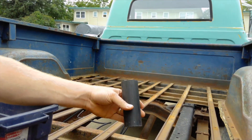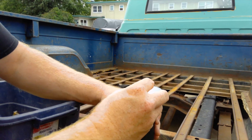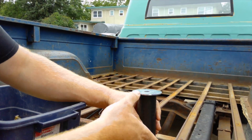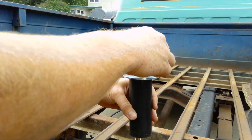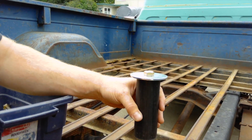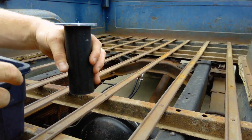Each of these spacers has a washer on the top to make up the five inches, and then the bolt goes through here, through that, and into the chassis where they're bolted down. This will be done like a body lift on a four by four.